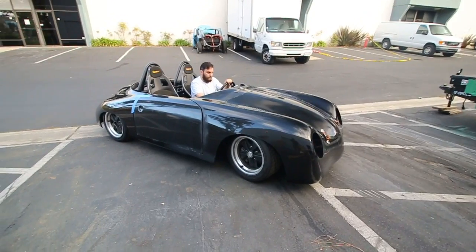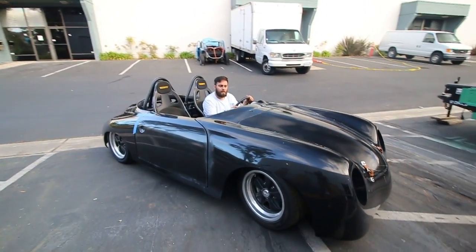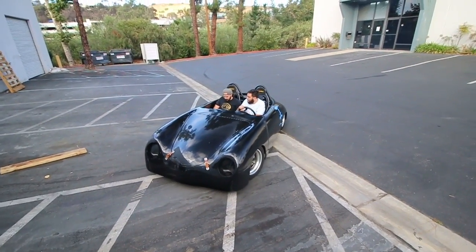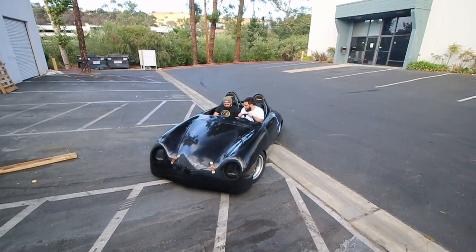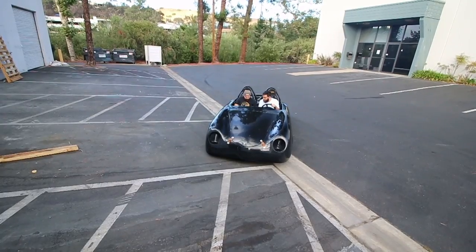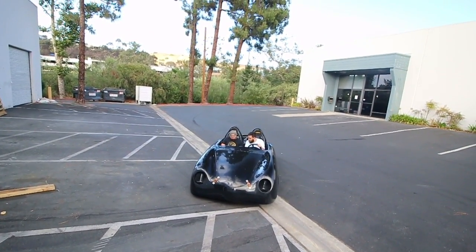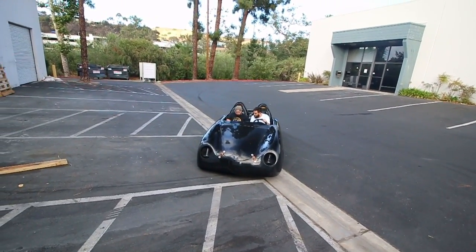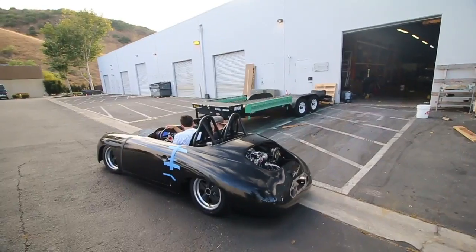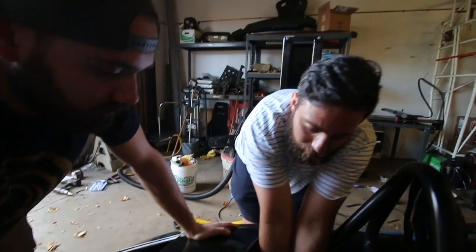Doing it. It's gonna do the same thing. I did see O2 out of range pop up once before. That's where it stalls every time. It's running really rich, is what's happening. And then it doesn't start right there every time. So it wasn't changing much for fuel, so we don't think that's the problem.